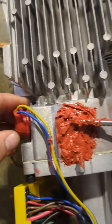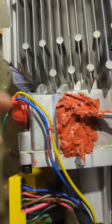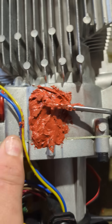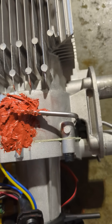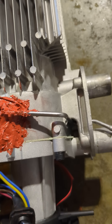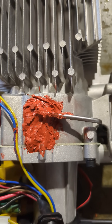Go ahead and put the heater back together. You might also want to do the same for this other one — I don't think this one smells on my heater, but if it does you can cover it with silicone, or replace it with a better one. That should fix it. Just go ahead and put everything back together and you should be able to enjoy your diesel heater without it making you sick or poisoning you with toxic chemicals.